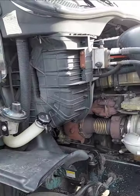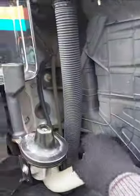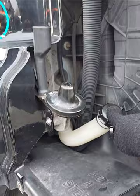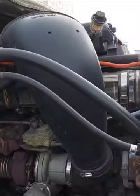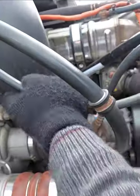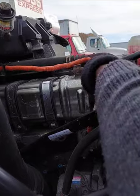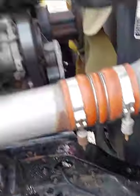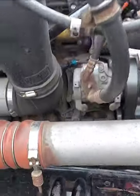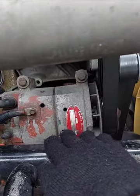I'm going to begin with the right side of my tractor. My washer fluid — this is where I put it. If you pop the lever, I will check it inside. My hoses, no cut or bubbles. My wires, there are no broken or exposed wires. I got my alternator right here, secure, no damage.